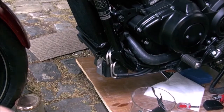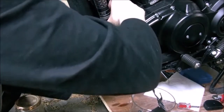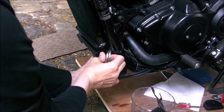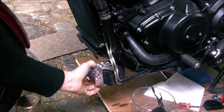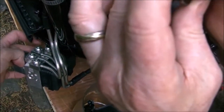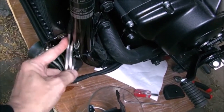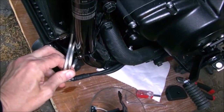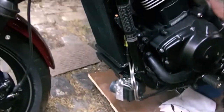Right, now this is a bit of a pull, so it's a bit scary. Grab hold of the ABS unit, stick your fingers in where you can, and you can squeeze it between the frame and the radiator, and there it is. Let me pull the camera right in. There's where we've got to get to. We've got to get to the top of these banjos. The two back ones are for the back, two front ones for the front. Bear in mind, those are Torx heads. Yep, and these are quite tight going into the frame. They will pass through it, but you can almost wiggle it in. It's just a pinch to get it out. Okay, so nothing too scary. Yet.